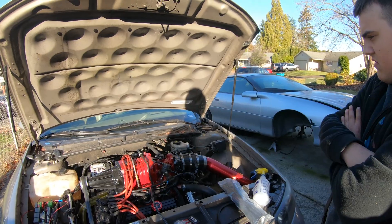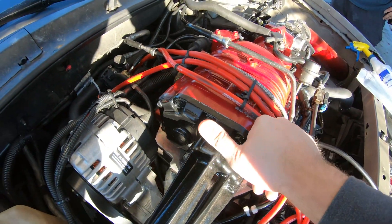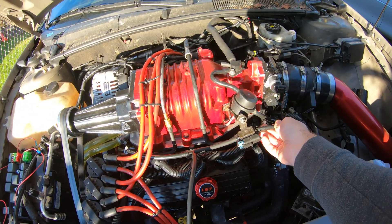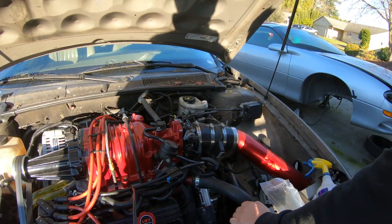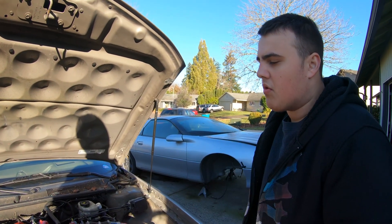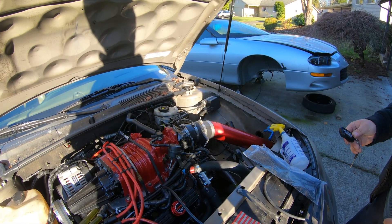What were those connections at the back? Those are for the evap canister and the EGR valve. Since we don't have those anymore, they're just sitting there — I think we should clip them at some point. We're going to pop this off to see how that changes vacuum. As Tristan mentioned, this is for the bypass valve. If you just leave it unplugged, it will still work with just the normal boost pressure — it won't let the PCM tell it what to do. I could probably even just delete this because I don't plan on running it.